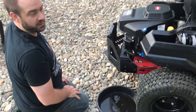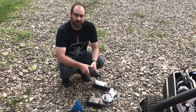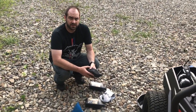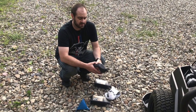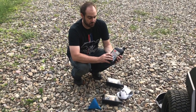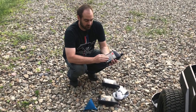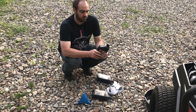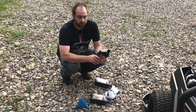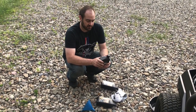Next we'll take the filter out — I'm going to let it cool down a minute longer. For the oil change, our area of the country and our temperatures said we could use any of three different grades of oil viscosities. I had this Wolf's Head Super Duty 5W-30 in the garage — I get this at Sam's Club. I'm really happy with this oil; it's a semi-synthetic and it's going to be perfect for the Toro. I didn't go out and buy the Toro brand oil when I've got oil that meets the necessary requirements at the house.